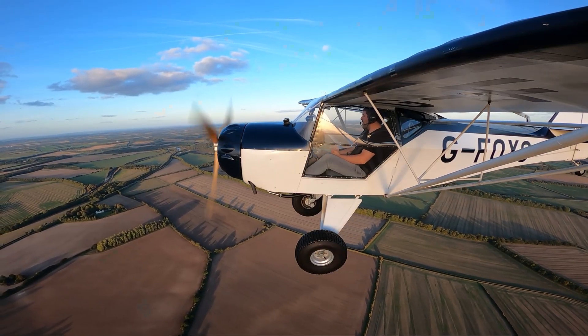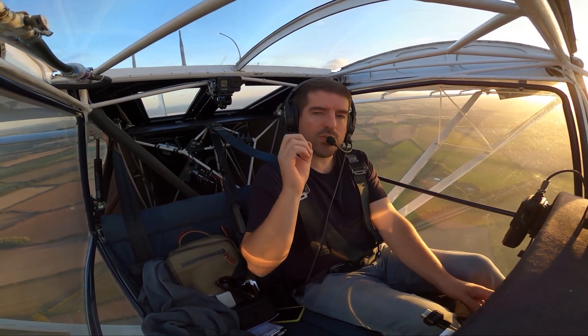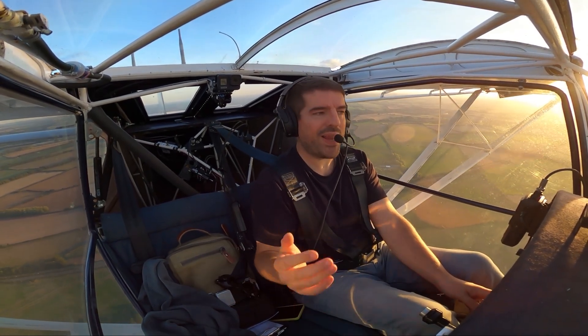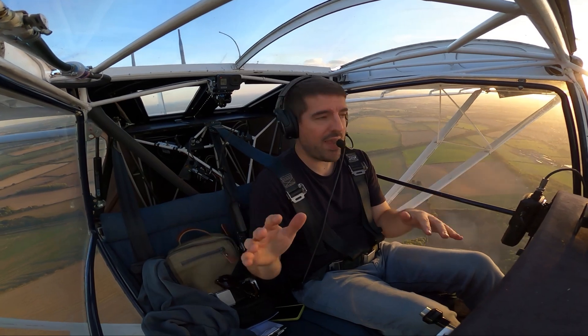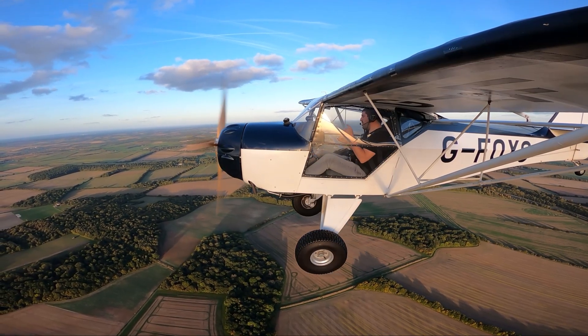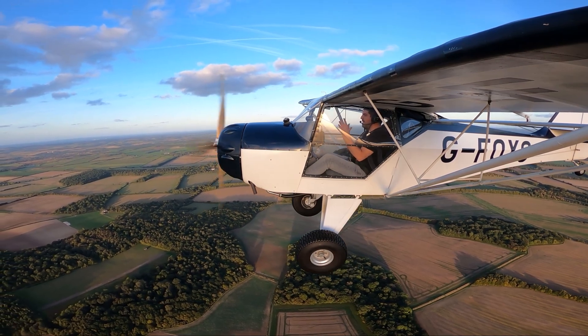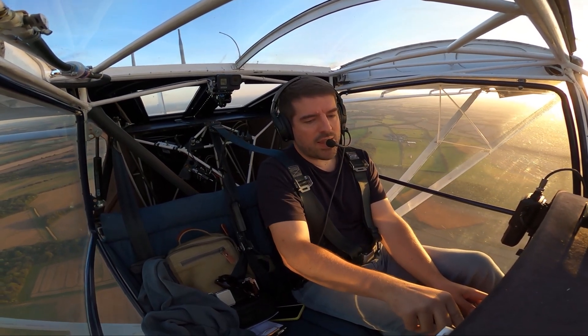That seems to have made a big difference. At the same time, I replaced the fuel pump. I discovered that the pulse line, which comes from the engine to the fuel pump to drive it, was ridiculously loose where it was connected to the engine. So I'm pretty sure the old fuel pump wasn't really working anyway — I wonder if it was just gravity feed allowing fuel to be sucked through to the carburetors. Big disclaimer — I don't really know what I'm talking about! But with the fuel lines replaced, the fuel pump replaced, and the carbs rebuilt, I refitted everything and started it up. It took a long time that first time because the carb bowls had to refill, but once it got going, it was absolutely sweet. I've never heard this engine run so nicely.